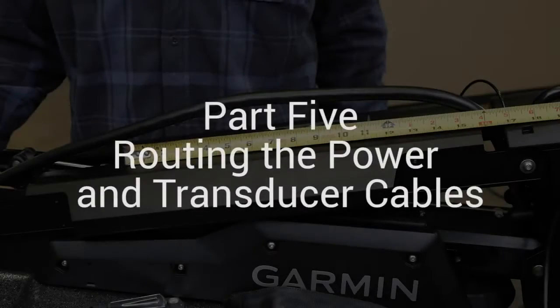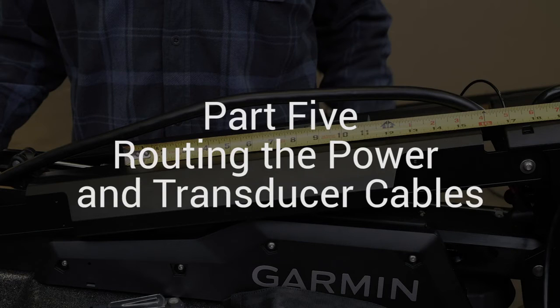We will now show you how to route the power and transducer cables. For this section, we will be using parts from bag F. To avoid damaging the power and transducer cables when deploying and stowing, along with avoiding interference, you must route the cables through the right side of the mount. There are only mounting points on the right side of the mount with the motor pointing forward.